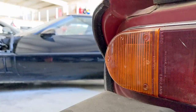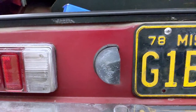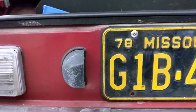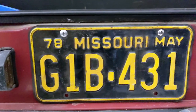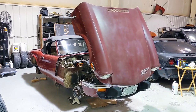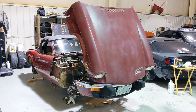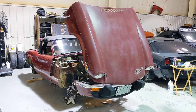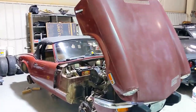Apparently the rear sag is due to the spring wearing out. There's a reason why Triumph engineered the spring the way they did — it has to do with wheels tucking in on earlier models during hard cornering. On these 1500s, especially the late ones, the spring is so soft that over time — especially if you're a particularly rotund individual — the spring will wear out.